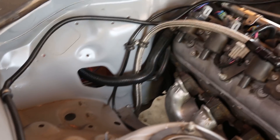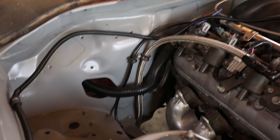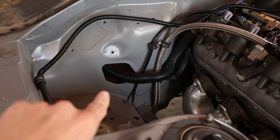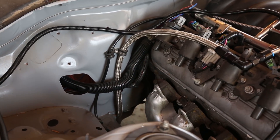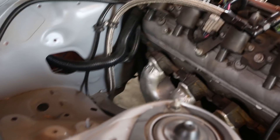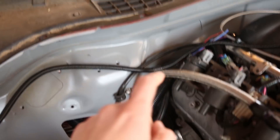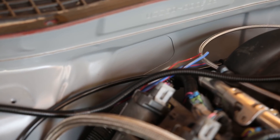Originally my plan for the wiring was to go through this hole right here in the firewall. I had blocked off this plate and that one up there where some factory wiring went through, and I was just going to use this one and make little block-off plates once the wiring goes through. But I'm realizing I don't like this big jumble of wires jammed against the firewall and the passenger valve cover - it's getting in the way and it looks messy. I think it's going to be unreliable being this close to the exhaust. So I'm going to pull all the wiring out and drill a hole through that AC block-off panel up there and run my main cable through that, blocking off this piece entirely.